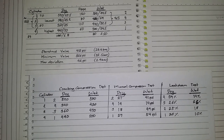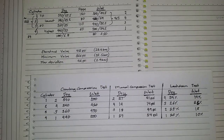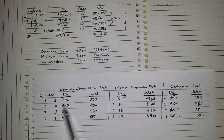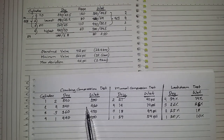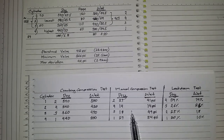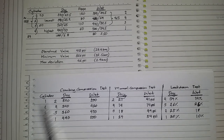So anyway, performing all these tests eliminates guesswork, and I can now safely conclude that my engine has either a worn out piston ring, a worn out cylinder sleeve, or a worn out piston. So particularly cylinder number 2. The next video that I will make, I will bring down the engine. Unfortunately, we have to do that. But anyway, I do believe that's it.